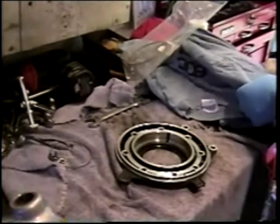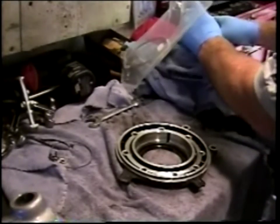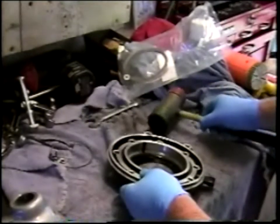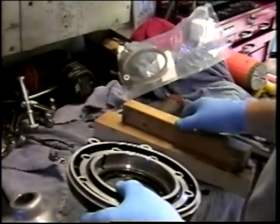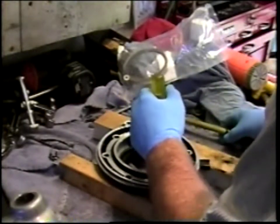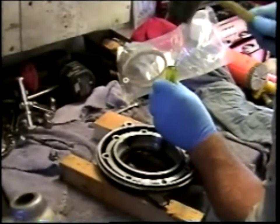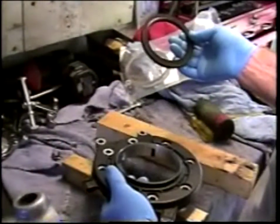We're still letting the oven bring the bearing and crown wheel up to temperature, so let's hammer away at the seal in the old final drive cover. I usually have a collection of various parts around here, so we'll support the final drive cover with that. Grab any old tool, because we're going to hammer on the deceased bearing seal here and just see if we can pop it out of there. So there's the final drive cover minus the seal.